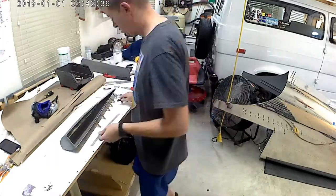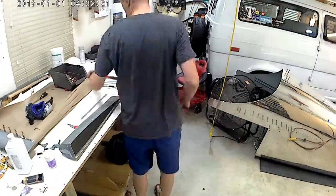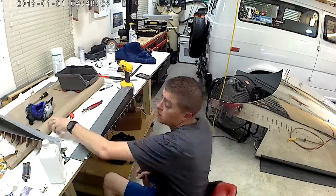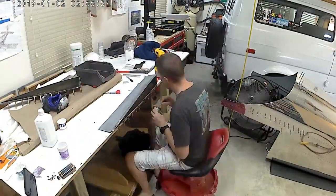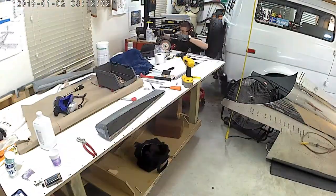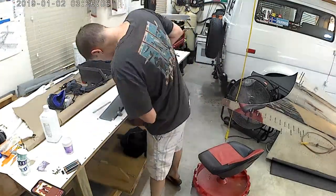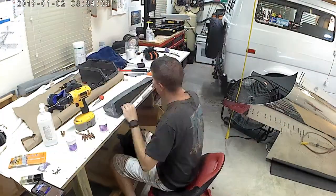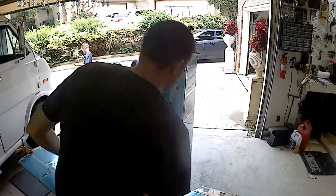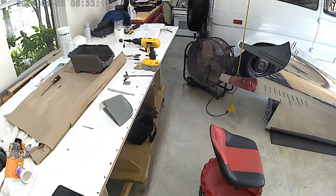On every single fiberglass part I made essentially an aluminum strip that I bonded inside of the fiberglass part, because I didn't particularly like the idea of drilling a hole, sticking a pop rivet down in there, and squeezing it with only the fiberglass to grab onto. To me, fiberglass is too brittle for that. I know there are tons of RVs out there that fly just fine with just the fiberglass fairing pop riveted without an aluminum strip epoxied internally, but for me I just felt like it was a much better option.